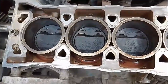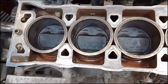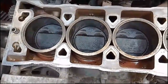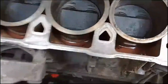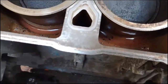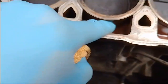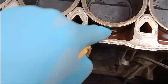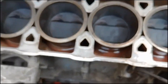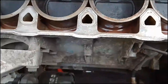Put some water in, the cooling water in. When it comes to the water, it's probably best, don't ever use tap water for the car. We know this, simply because this is where the water ends up. It's chambers used to cool down the chambers. If you get scale in there, imagine if you get scale around these pots, that won't help with the heat dissipation, and then the heat builds up, and then you'll start getting an overheated engine, which then, if this heat comes back to the head gasket, then it'll start warping it and causing all kinds of problems.